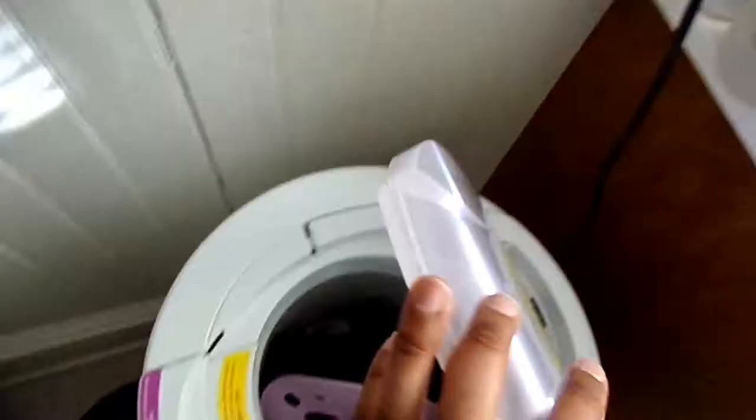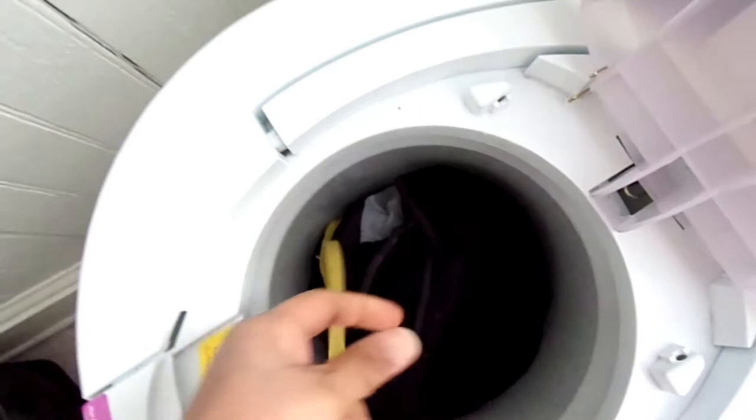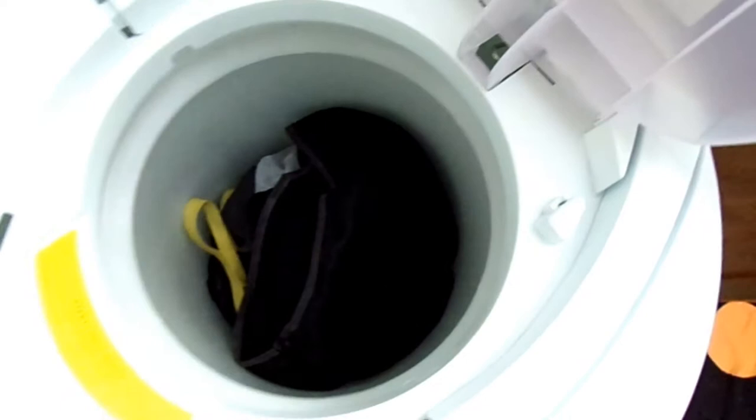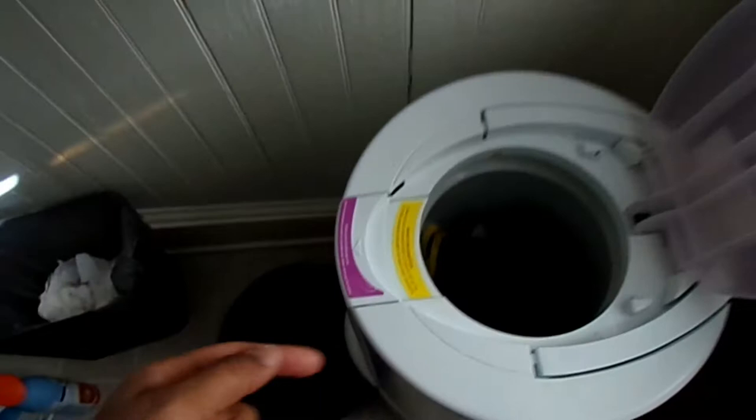When it's plugged in and you close the lid, make sure the lid is on top of the clothes. Once you put the clothes in, drop them in so the holes at the very bottom make the water go through. This is where the spout is — you put a bowl or container underneath and that's where the water will come out. If there's no bowl in front of the dryer, you need to put something there because as soon as you drop wet clothing in, it will instantly start leaking water through the holes in the front. It's a spin dryer so it doesn't use heat.